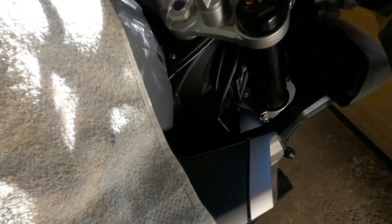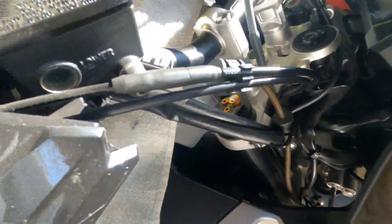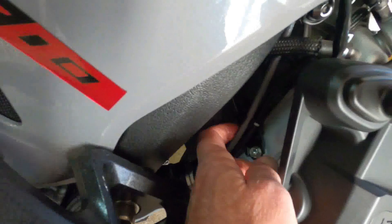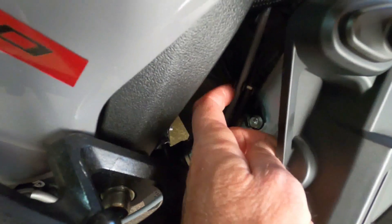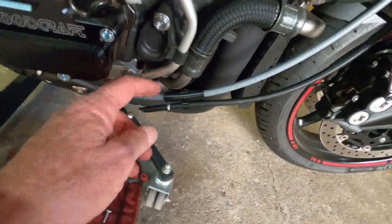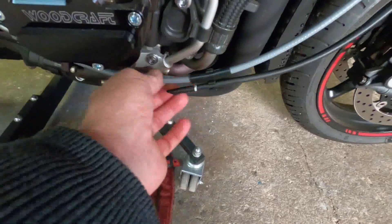You can see where the cable runs down and it's got a good bit of clearance now. If you want to get it a little closer to the upper triple tree, you can re-bend the guide with a long block of wood or something, tap it in so it's got a little less play where the cable goes through. When hooking up the clip, I bent it with a small pair of pliers and a heat gun just to give it a little bit more tension. The last thing to bolt up is pretty straightforward — I put a little piece of old fuel line to add a little diameter to the cable itself so the tube would be a little more stiff.